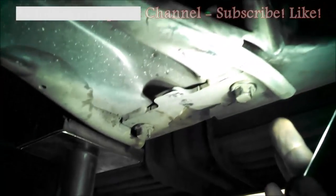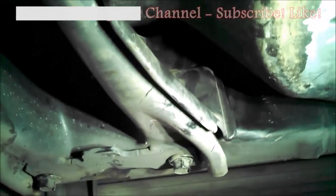That connector will go with the gas tank. Lastly, to get this gas tank out, I undid these bolts here — two 15 millimeter bolts. I also had to move the shield because there's another bolt: 15 millimeter on this side and 15 millimeter on this side. Then I can drop this down.